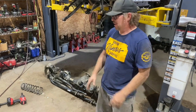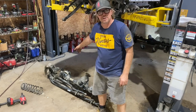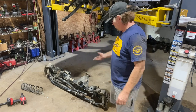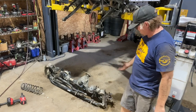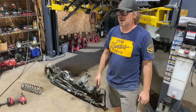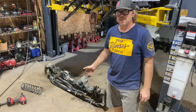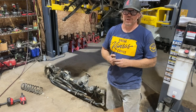I'm going to wrap it up for this episode. I have a Dana 30 that came out of a JL — it has the front axle disconnect on the long side of the axle tube. Is this axle good for anything? Yes: if you have a Dana 30 in your JL and you bend it and need a new one, this would be a good one. Would it be good to swap into something else? Probably not — it does have a high pinion but doesn't have any sort of locker. I'm not really sure what gear options there are because I assume most people would step up to a Dana 44 rather than re-gear the 30. So there's not really a whole lot of value to it other than someone who needs to replace one they bent or ripped. I'm going to push it outside and deal with it after I'm done playing with my Jeep.